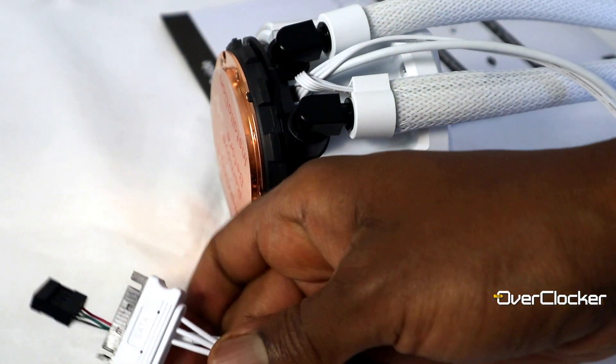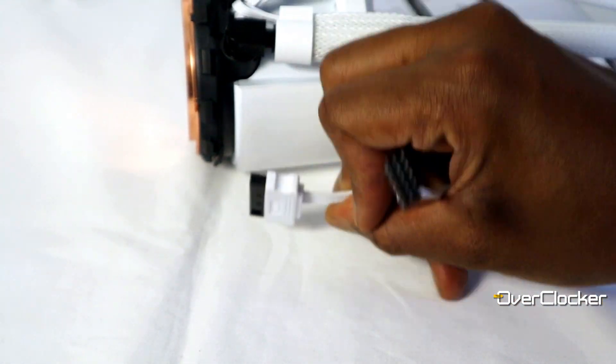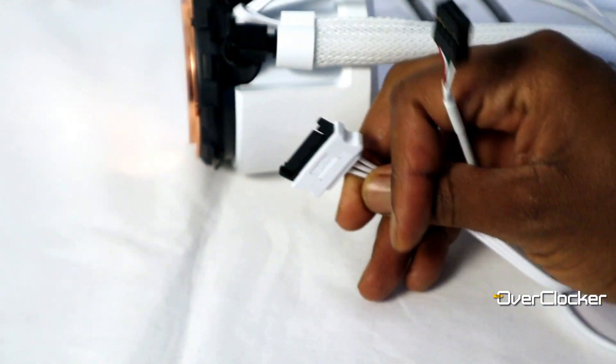With that said, there are actually only two cables here from the block: a power cable and your comms cable. That's literally it, and you can control everything from just these two cables. What I do is plug the RGB aspect of the fans directly onto my motherboard RGB header, and I plug the fan header onto the motherboard as well. I do this because I have better motherboard control over the lighting and the fans rather than going through the Gigabyte control center.